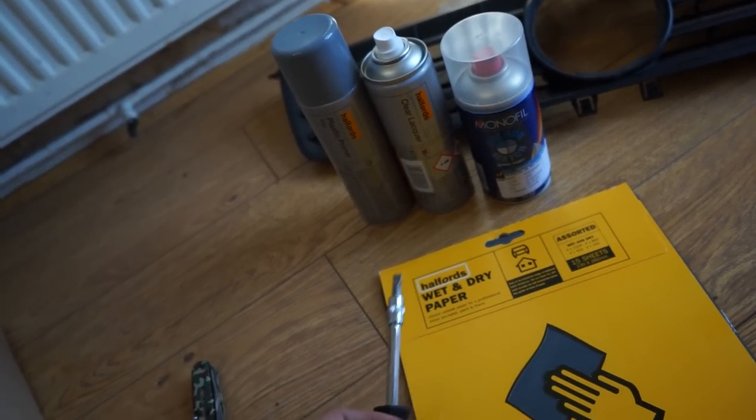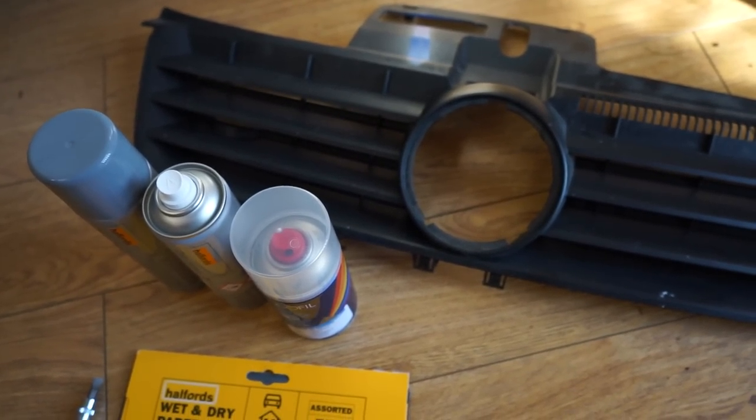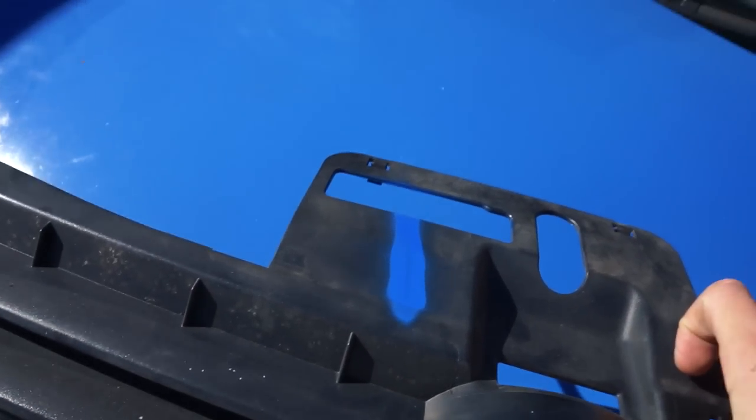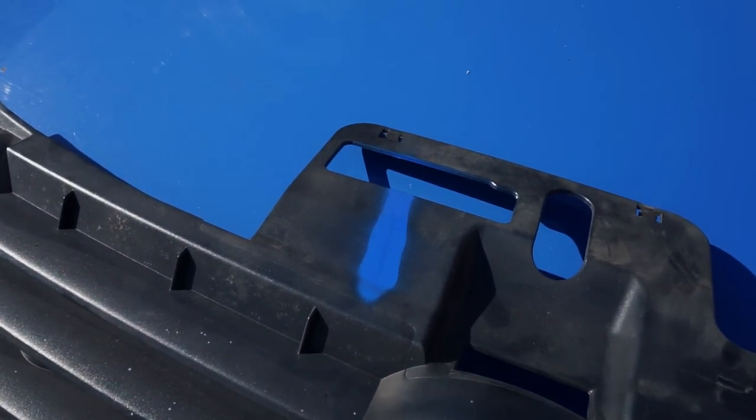There is actually a proper tool you can use, but a flathead screwdriver will do. I've also painted a plastic piece from a different video with the car colour so I can compare the two. To find your car's colour code, go into the boot, lift up the under tray, and on that you can see the code — mine says LA5F. From that I went to a store that could mix me up some paint, and comparing that sprayed piece to the car, it looks like it's the same colour. That looks pretty good to me.